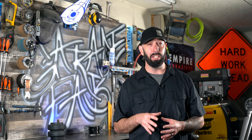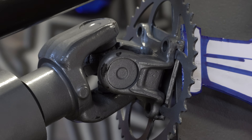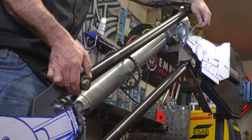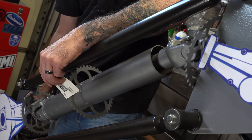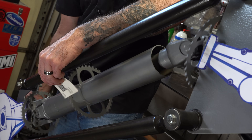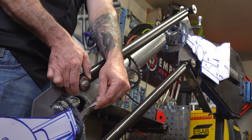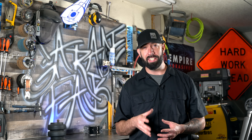Things don't get weird until you bend a U-joint. So let's extend our suspension fully as if we're lifting our vehicle. That's a nice bend right there. Now check this out — the transmission is still turning at a constant speed, but the drive shaft... Do you hear the pitch change? This bent U-joint is causing the drive shaft speed to oscillate. And the oscillation is going straight into the differential.